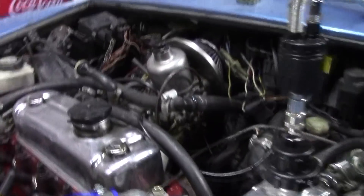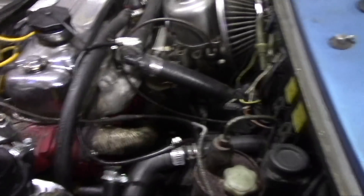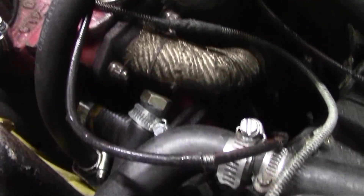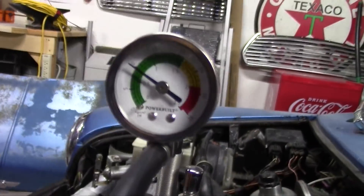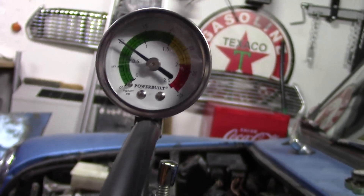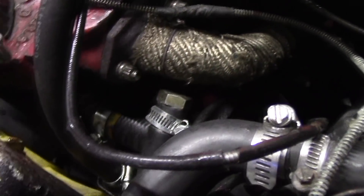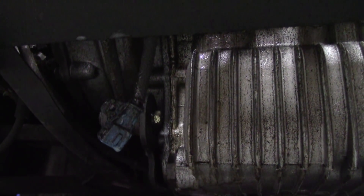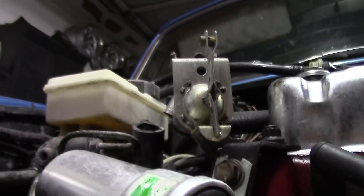There's a leak, and I haven't been able to identify any other leak whatsoever. I've come over here and looked everywhere I possibly can for other leaks. The pressure has already dropped down to 10. It's dark in here now, but when I come down here you can see it's leaking off of that connection.